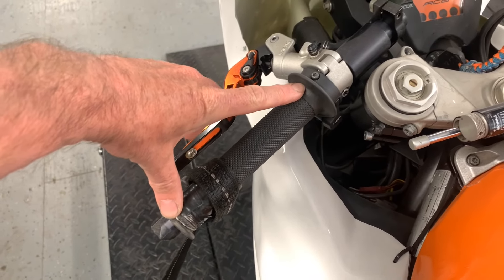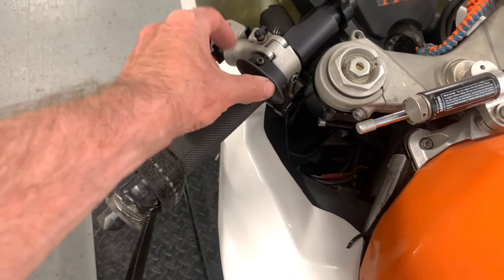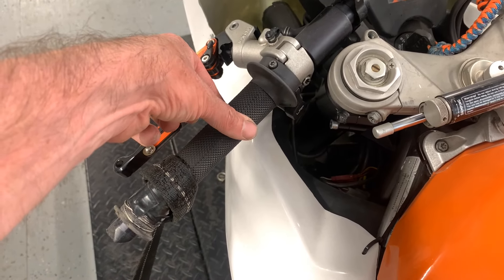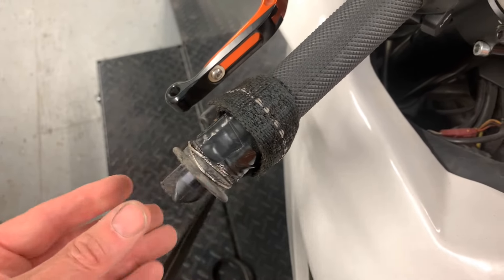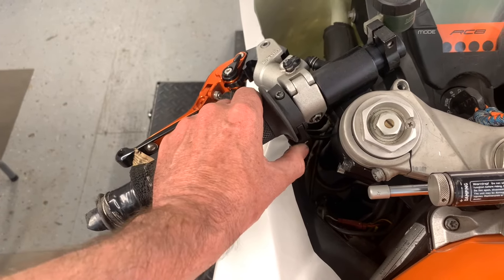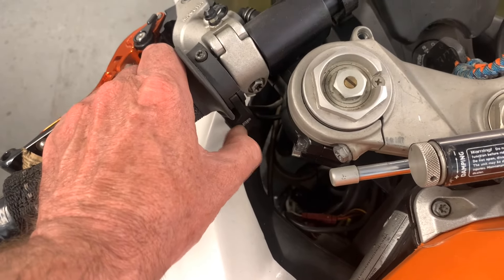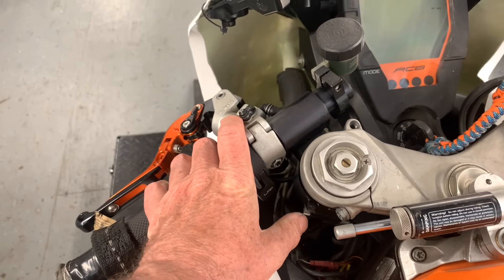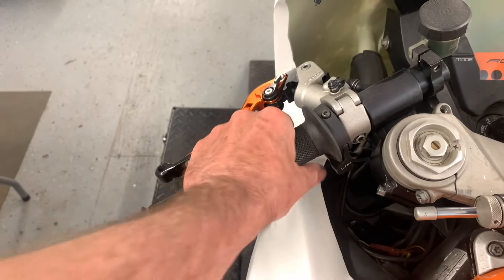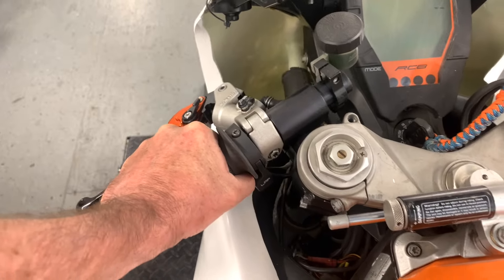The other thing that has to get done is these grips. This has a really long grip on it. What I figured out is that on the stock bike there's another switch gear that sits in here, so this would actually be moved further down. Somebody has taken an extra piece of grip and locked it on the end. That's all going to get changed. I'm actually going to put in a MotoGP-style switch gear in here. I may or may not wire the lap timer into that — I haven't decided yet. But it will go in for two purposes: it'll allow me to align the grip better and it just looks cool.